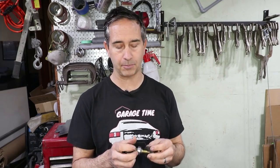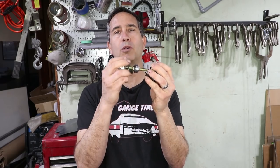And in addition to that, I can attach the master cylinders to the pedal box using this adjustable balance bar. That will allow me to mechanically change the force that the brake pedal exerts on each master cylinder, so I can have even more control over the front to rear brake bias.